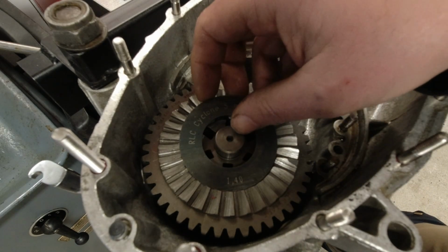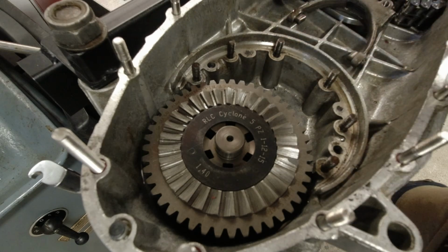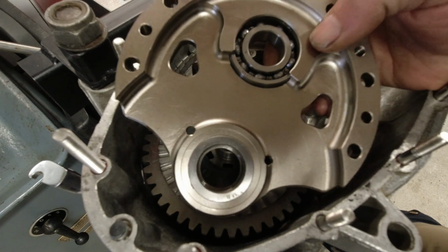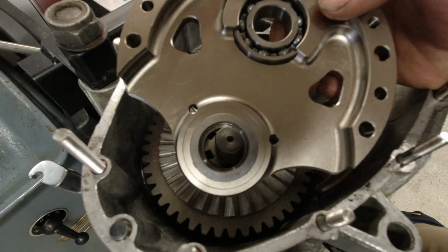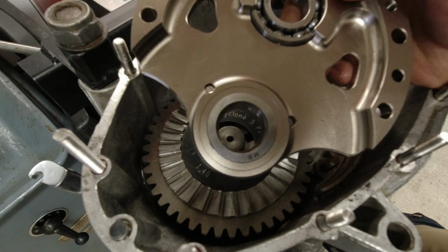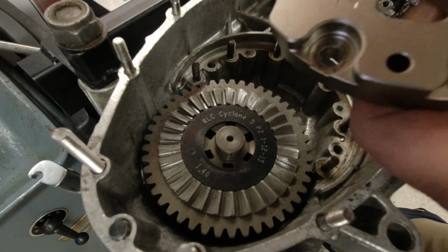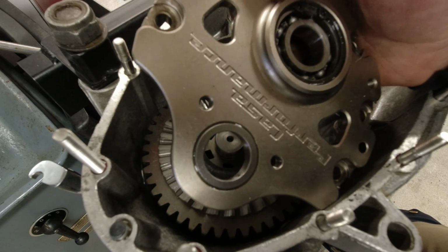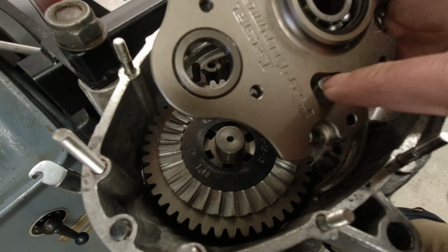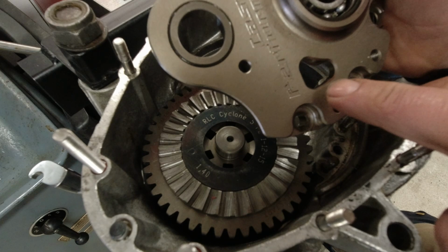So now I'll stick this on there. I'm really hoping that I don't have to do too much work in shimming this, and it should go together okay. Now another hot tip is, with 5-speed gearbox fitting, I know it's more money, but if you can afford an expensive 5-speed gearbox, you can afford a new end plate. Highly recommend using the Casa Performance end plate. The reason for that is, you'll see in a minute when I go to stage 2, that you can see down into the gearbox when you're shimming up what I like to call the Christmas tree or gear cluster with 5th gear.